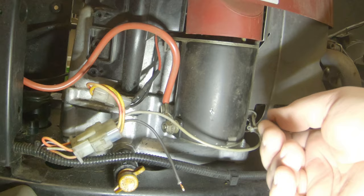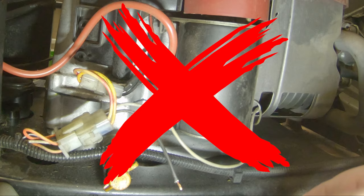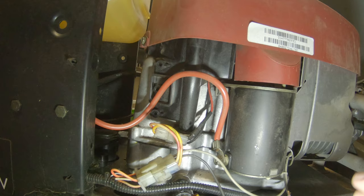What this effectively does — and this is for testing purposes only, I can't stress this enough — don't cut this wire and try to use this mower, because your key switch will not shut power to the coil. The only thing it's going to do is shut that solenoid off on the carburetor, and it takes a minute to stop. Do not cut this and try to use your mower.